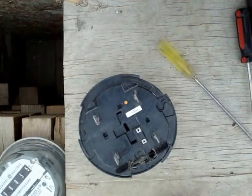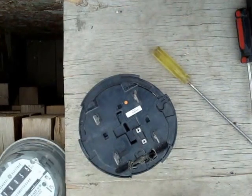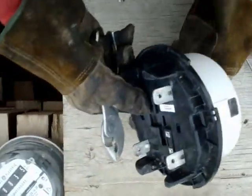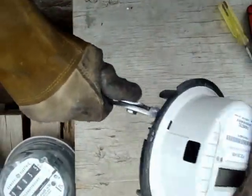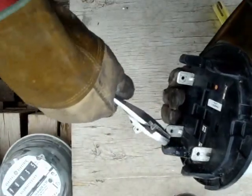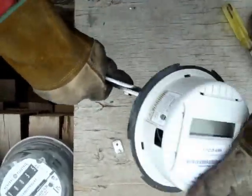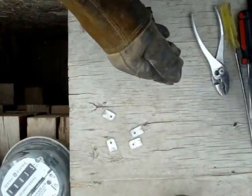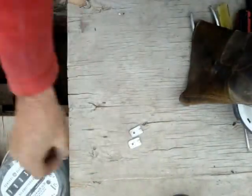Put on your gloves. You can do it barehanded, but your fingers will get tired. Take your pliers, hold it like this — I use the meter as the leverage point and break these off. You'll never be able to push these little tabs back and take it apart, so take them out whole and break them off. The meter is larger, easy leverage. Throw them in your number two copper.